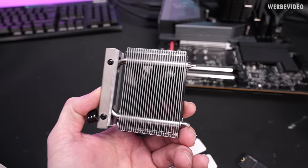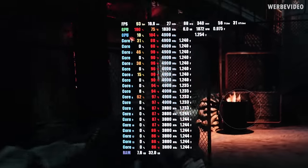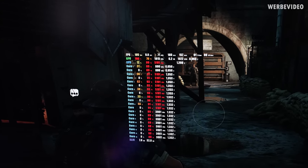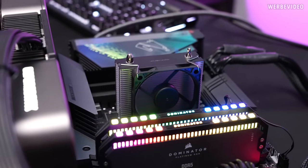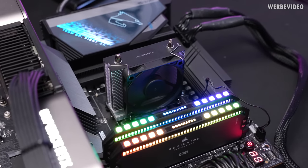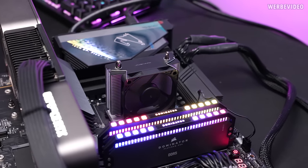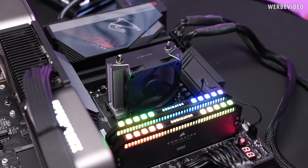It kind of looks like a CPU cooler. Installing the M.2 drive was no problem at all. It's sometimes throttling down to around 4GHz, but most of the time it looks like 4.9 to 5.1GHz — not bad. If you have this inside your system and your air cooler suddenly fails, you can use the tiniest CPU tower cooler ever made. This is running the 13600K with enormous heat output, and the temperatures are pretty solid — quite impressive, especially since I didn't even clamp it down; I just applied some Cryonaut and pressed it on.